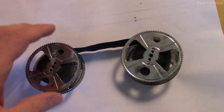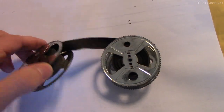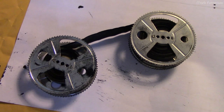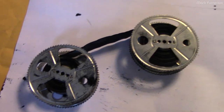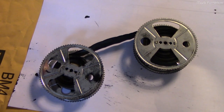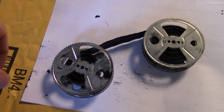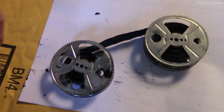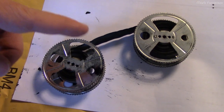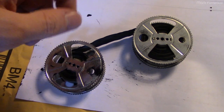I'll put it in the machine and see what kind of impressions we get. If this fails I'll just order another ribbon, respool it, and probably have to re-ink it anyway — but I might as well try this and save ten bucks. After working at this for a while though, I think I'm going to give up on this particular ribbon. It's too far gone — the ink isn't really wetting it, it's beading on the surface, and even dripping it in from the side it's not really getting into the ribbon. I'm going to bite the bullet and buy a new ribbon.